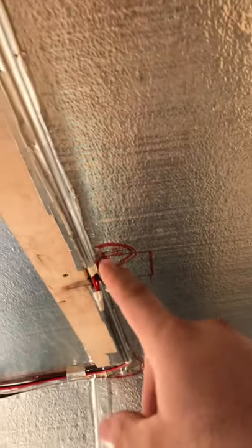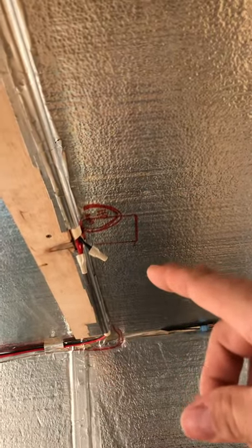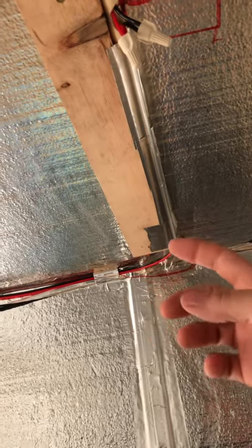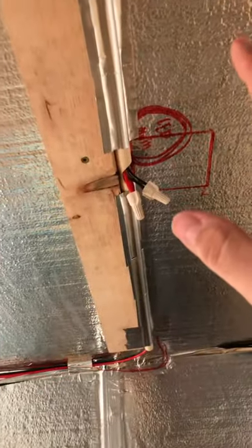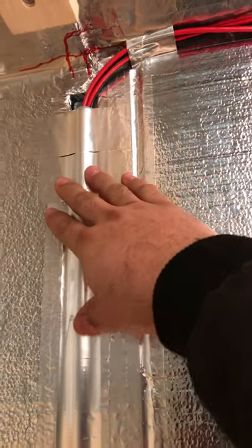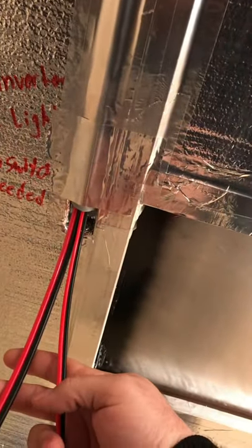You can see a bit more of the conduit work here — I've got conduit running anywhere that comes out into the cabin, so in the future if I ever need to change wiring, I'll have a hole where the LED goes and access to the conduit. The corner will be all open; I can take a single piece of crown molding off and access the wires. Once we cover everything with insulation and wall material, I can still get back in without ripping the whole thing apart. Same thing here — conduit inside the wall, same thickness as the studs, so it lays flat under the shiplap.